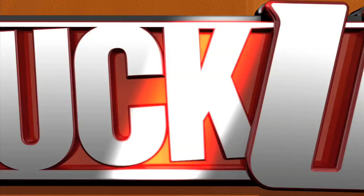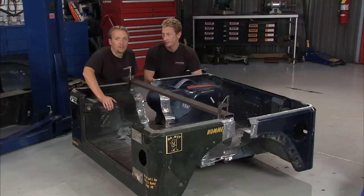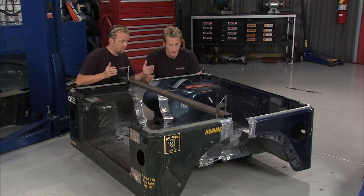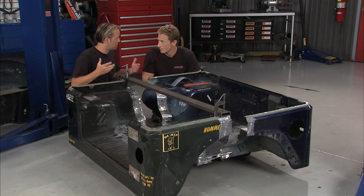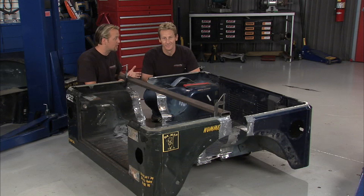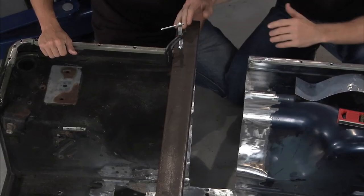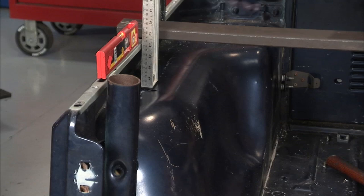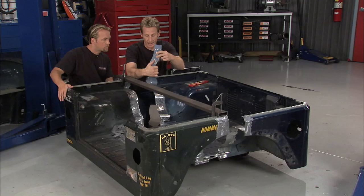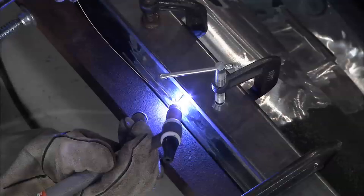Now you can see our two tubs are cut apart, but it didn't just magically happen — there's a lot of time and effort that went into making sure we cut it straight. This could be a little bit tricky. The first thing we wanted to do was mark the center point of the wheel well on both halves, so you know you're going to be nice and centered and when you put everything back together it's going to look right. If we want to reuse that factory fender flare, we can do that too — that's what this is all about, reusing parts and saving money to make something cool. Then we made our measurement to find the center point of the wheel well and put a steel beam across the middle, about 24 inches out on either side. We used a level to find the vertical center point and used a scribe to mark it, then made up a little template to connect all the dots and get the line needed for a good cut.